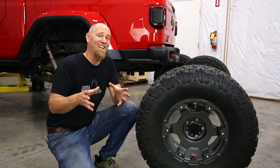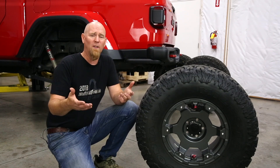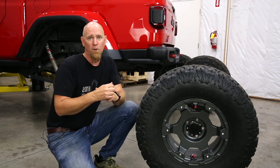What is the best practice for rotating the tires on your four-wheel drive? First, find out what the manufacturer recommends for your specific tire. On our Gladiator we have the 35-inch Patagonia MTs, and Milestar recommends a rotation interval every three to four thousand miles, rotating all five tires including the spare in the rearward cross method.